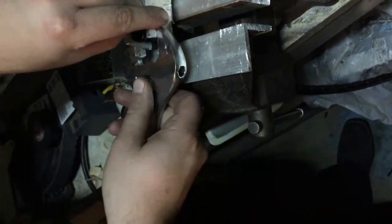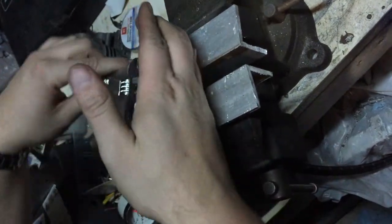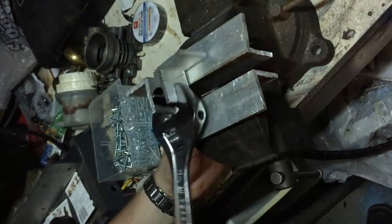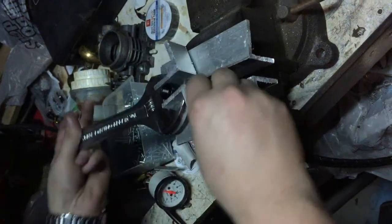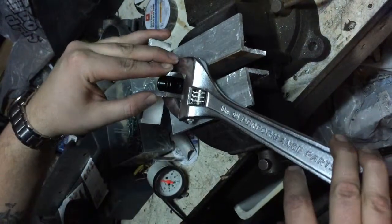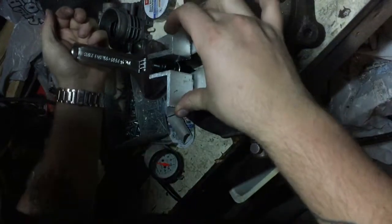Here I'm messing around trying to get those aluminum ends onto the crescent wrench, which is mostly a waste of time. It will prevent scratching in this case, but over time the fittings end up getting scratched anyway. It's not going to work once the line is actually inside the engine bay where there's no real clearance to be moving things around. I had a lot of problems using this wrench in general with its size — once it's up against the firewall, you really don't have much room to move around. It took quite a bit of doing just to get everything buttoned down tight so the fuel wouldn't leak. A smaller AN wrench is going to take care of that problem.